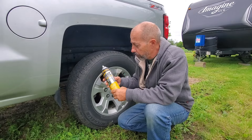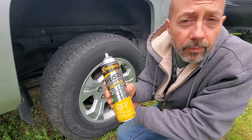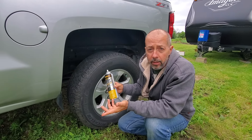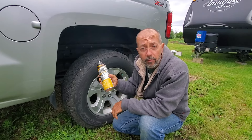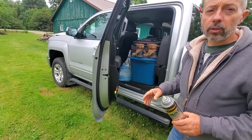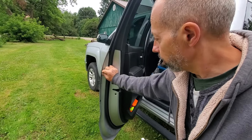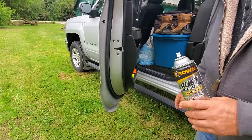A few years ago I discovered I can buy the oil from the same people I was paying to do the job. Now I just climb under there — sure it's a bit messy, but it saves about 70 percent of the cost. The vehicle is already pre-drilled; you just come along and spray inside the holes for every panel. There's no way to stop rust completely, but with regular oil spray it minimizes it and does a great job.